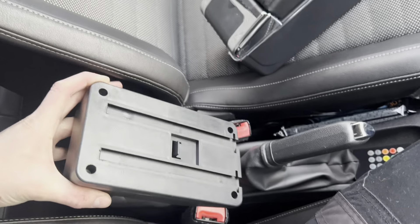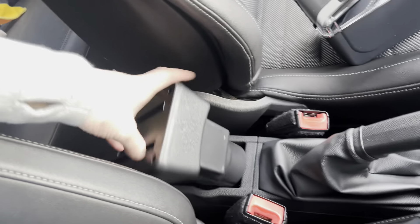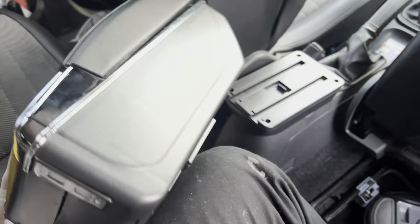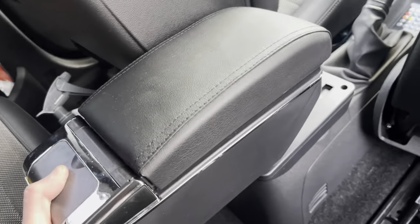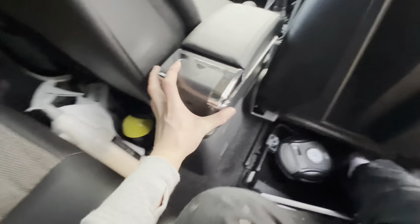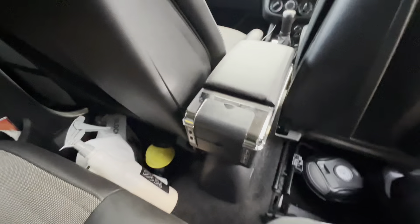We're in the car now. This is the part that goes in the cup holder of the Corolla, and then the armrest slides straight onto it. You don't want to put it in the wrong way because it won't sit right — spin it around so it goes in place like that. Then you get the armrest itself — under it are the little rectangle slots with the black screws next to the gold ones — and slide it straight into there, then push it forward.